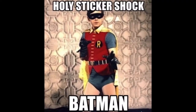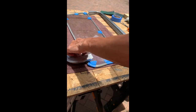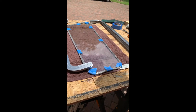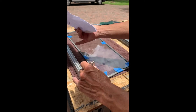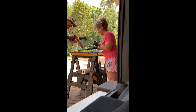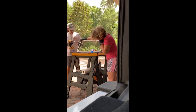After getting over that sticker shock, we quickly decided we'd either repair the damage ourselves or cover it up with duct tape to avoid leaks, and just get on the boat, go sailing, and worry about the less important stuff later. The window installation process involves setting the glass into the glazing channel, then a helper puts a bead of silicone on the inside of the window gap. We put silicone in there — I realized this was going to be a half-day project and hadn't even gotten out of my pajamas yet, but it was the perfect opportunity to get them done while the boat was in the shop. It only ended up taking about an hour to do all four windows. Based on the wear and tear of the old seals, we potentially avoided some pretty serious leaking issues.